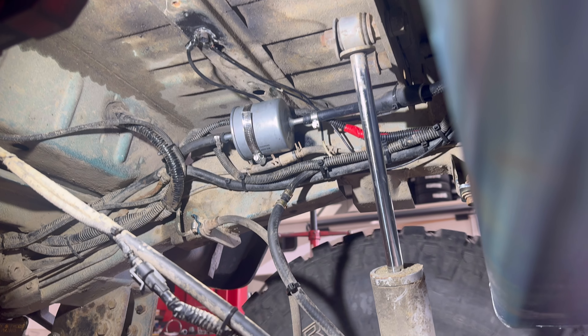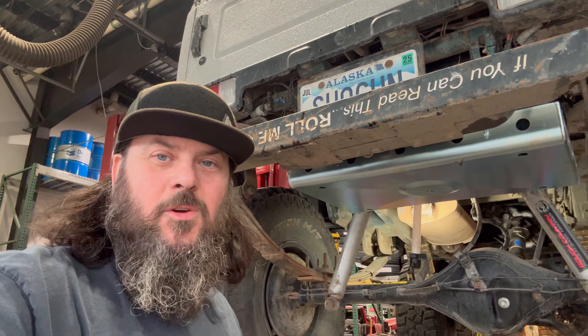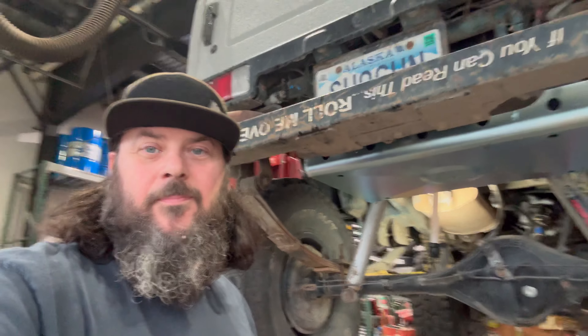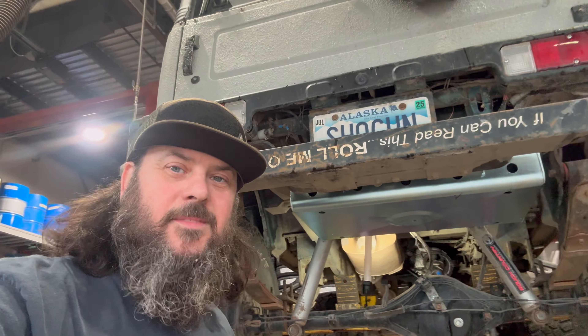I trimmed all the fuel hoses, welded that little bracket on there, put a hose clamp on it and some rubber pieces from a door seal — that thing ain't going nowhere. I'm going to reroute my ground wires on the backside of all that, then police up all this wiring and zip tie it all together, making sure nothing's rubbing. I put a bunch of zip ties all over everything, secured everything down, got my ground wire moved out of the way, and all the wiring's policed up. That's pretty much a done deal. Rig's coming right along — I'm just about done building this thing.